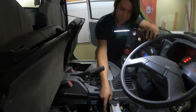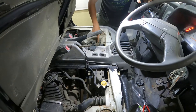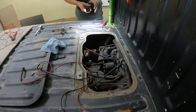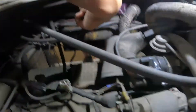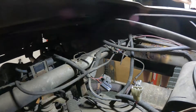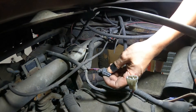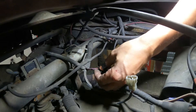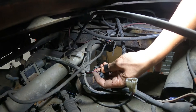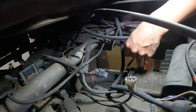Susan hopped underneath and followed the wires. They go down and into the main harness, which runs across to the frame rail and then back. You have to follow it along and then down the transmission cross member — and right there we've got a red and blue wire that comes out, and here as well another red and blue wire. We were working with a thinner gauge wire up there. With the ohmmeter connected up to the front plugs, we do have connectivity, so we know that's the same circuit.